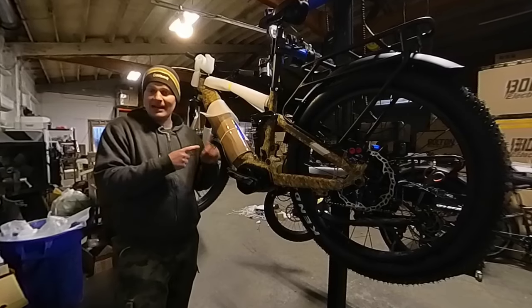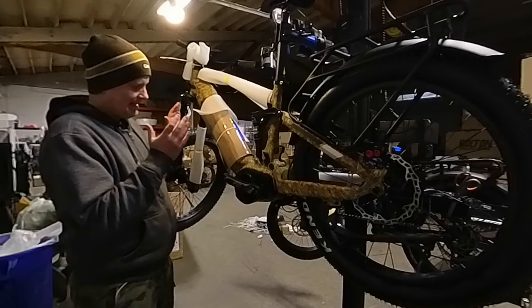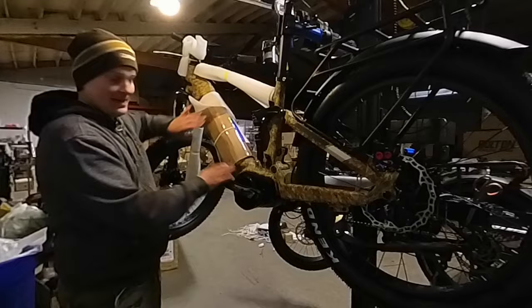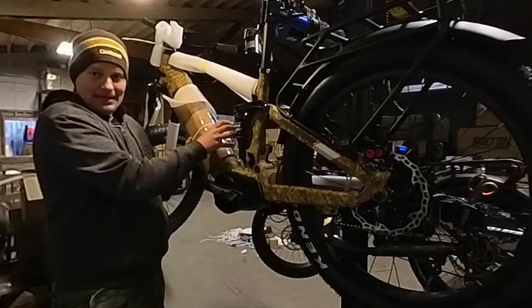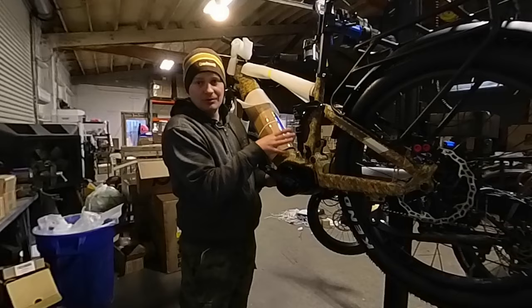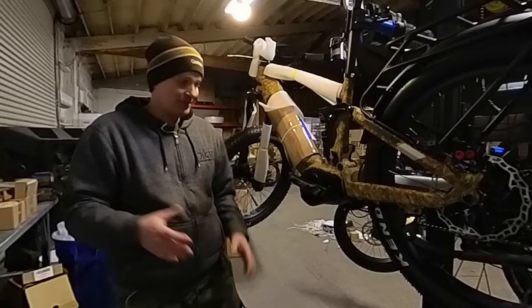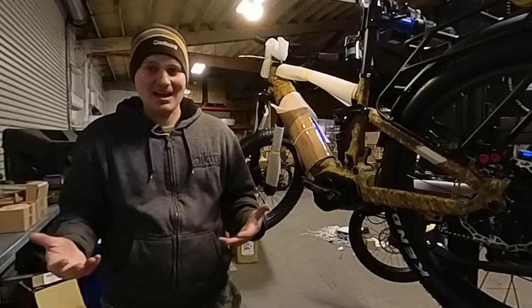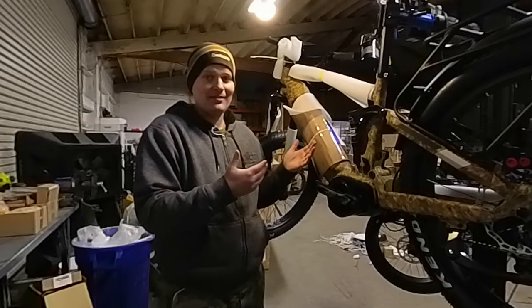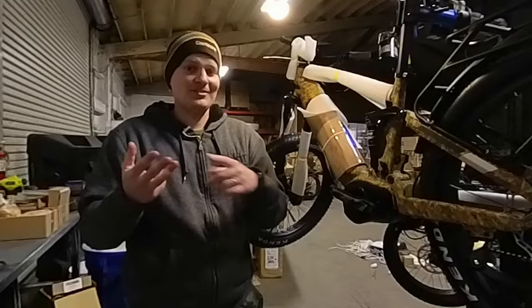This is the Uniro Specter S. We're setting it up for a customer who had a special request. This bike is already designed for two batteries — one fits in the frame, and a second fits in the middle of the triangle with a port already built in. So effectively there's a parallel circuit of sorts designed into the frame. The customer's request was to add a line for a third battery, and Uniro just announced a crowdfunding campaign for a new bike with one, two, or three battery options — so we'll likely see that from production bikes soon.